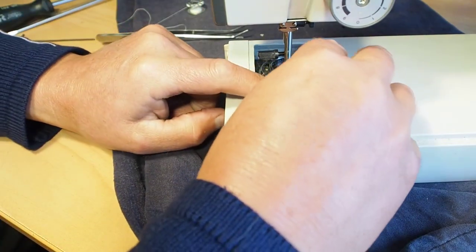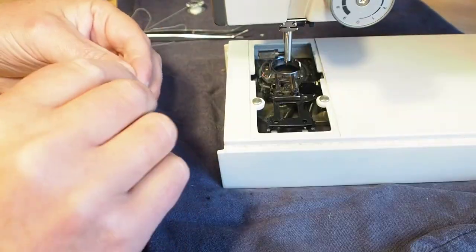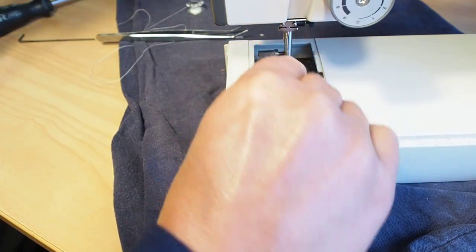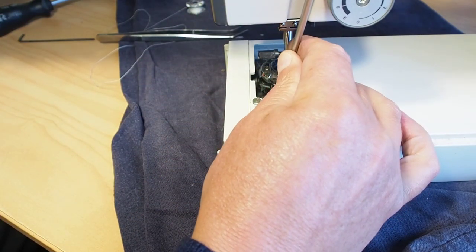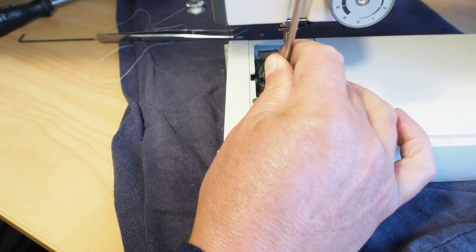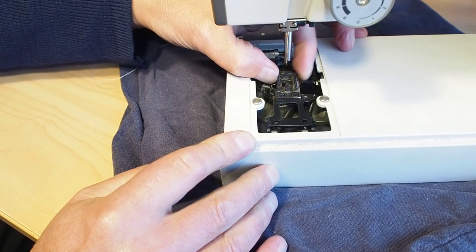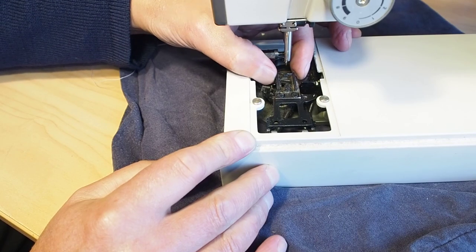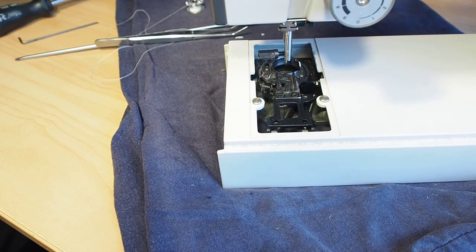If you do take the feed dogs out, you will need to realign them, and you do that by just loosely tightening these screws. You want them tight enough so that the feed dog doesn't slip around too much, but you want them loose enough to be able to position the feed dog while you've got the plate on, just to align the teeth in the holes. Just allows you to position the feed dogs to make them parallel with the holes there. It could be just a slight smidge tighter there, and then put your plate on